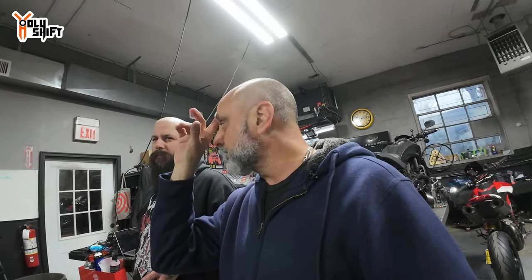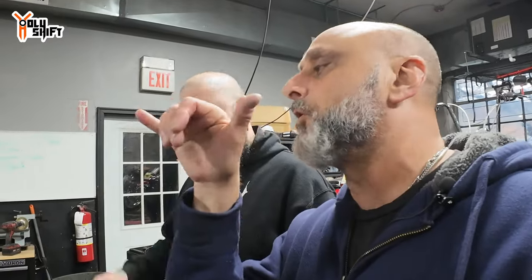Okay. So it's the RPM distance between the max torque and max horsepower. Did I get it right or no? That's what he's trying to describe. I've always known it as where the cam is supposed to come in, and they offer an RPM range, which would be the power band at that point. So where the cam starts to really come in, it's the zone where it's most effective. That's in dumbass terms from my terms.